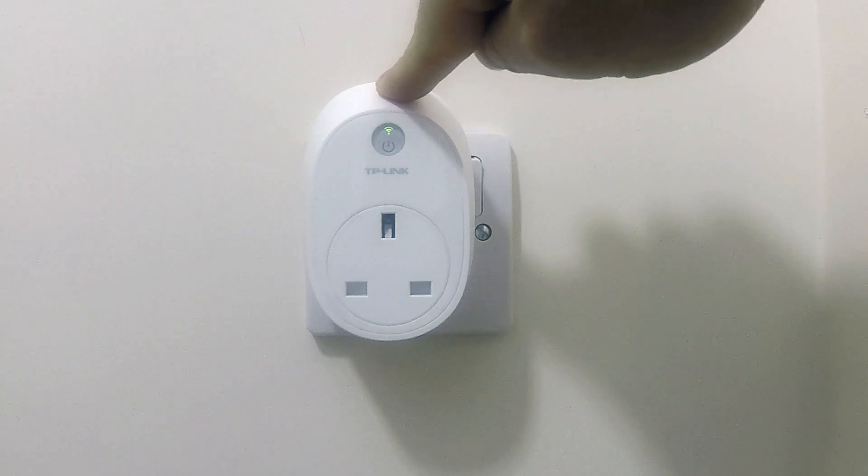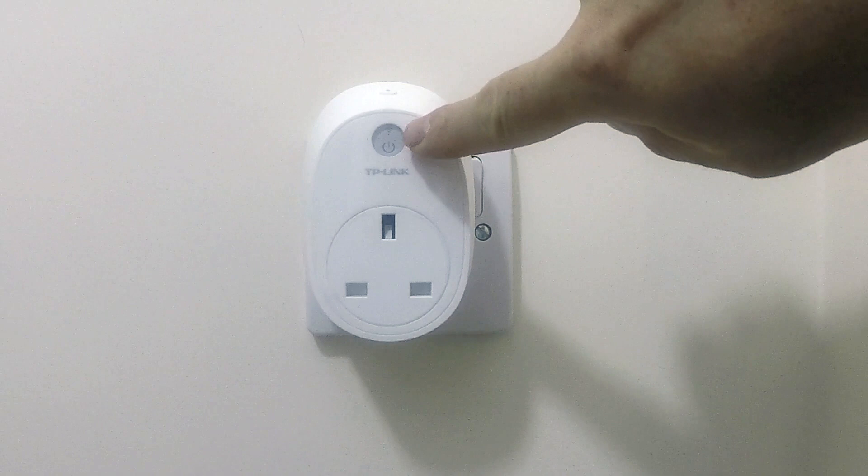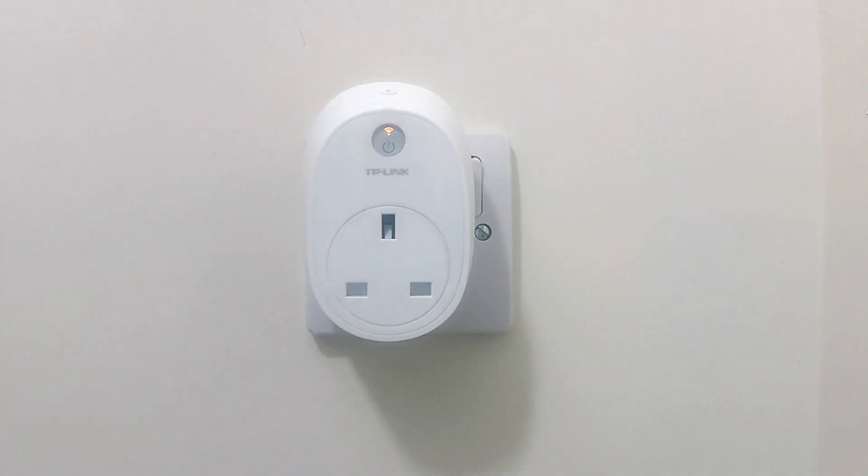While keeping your finger held down on the reset switch, you will find that the Wi-Fi indicator light will start to flash green and amber. When the Wi-Fi indicator light goes out, you can remove your finger from the reset switch. The Wi-Fi indicator light will again start flashing amber before the power indicator light lights up green. The Smart Plug will have completed its factory reset sequence when the power indicator light is green and the Wi-Fi indicator light again starts to flash green and amber.